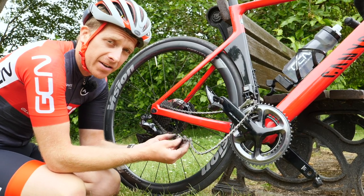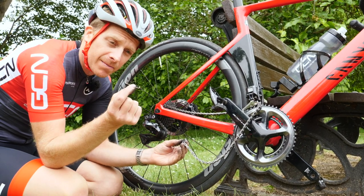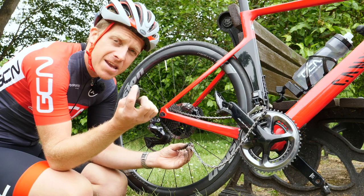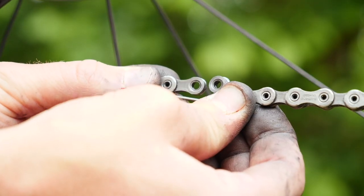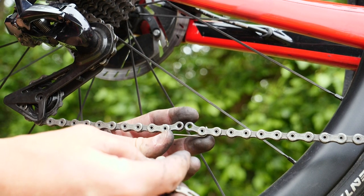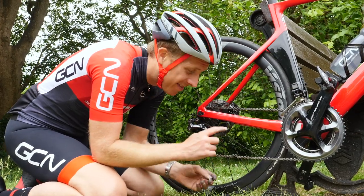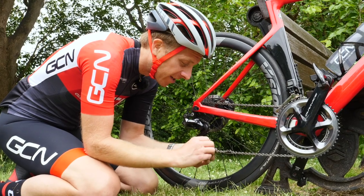This is one of those occasions where you wish you had three hands. In my case, I'm quite lucky because that little multi-tool from Topeak comes with this — it joins the chain together temporarily or just holds it in place, relieving you from having to do that job yourself. It's almost like an extended paper clip; you could even fashion one of these at home. Getting that chain held like so gives you just a little bit of room to play with. Trust me, it's way easier having this than trying to battle everything — it's an absolute nightmare, especially with a greasy, slippery chain.